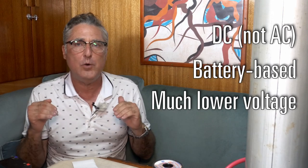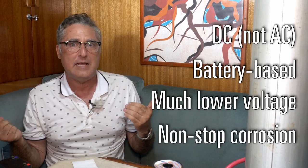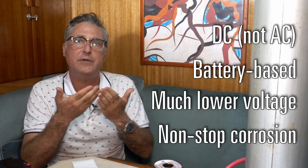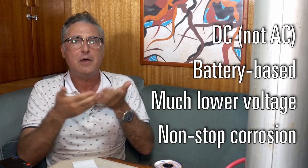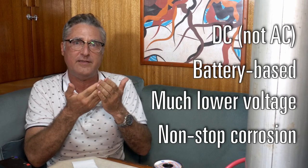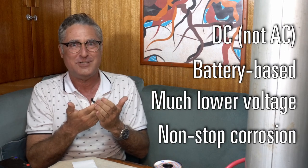In addition, on a boat, you've got this corrosion monster that you tend not to have in houses. And the corrosion will eke in there later on, and every contact will become a little worse every year. Now, eventually in this video, we're going to talk about how to find the problems. But what I'm saying right now is if you design your system so that it can accept a little bit of growing resistance because the rest of it's all stellar, it won't matter so much.